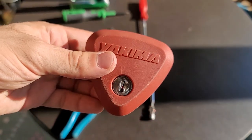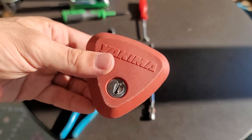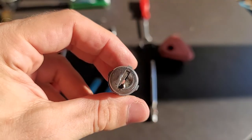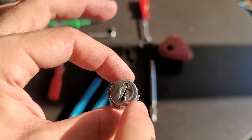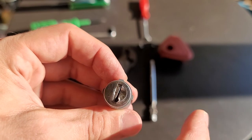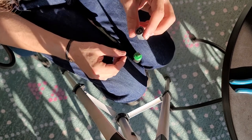This lock is now in the locked position because the half moon is facing right from the top-down direction, closest to the A. In order to unlock it, we need to exert clockwise pressure. So this is now locked, this is now unlocked. Likewise, if you're dealing with the whole cylinder out, this is the locked position — you can tell because the half moon is facing the rightmost extrusion when looking at it from the top down. Here is my own personal technique. I'm sure there are tons of better ones, but this one worked for me. There are many others like it, but this one is mine.